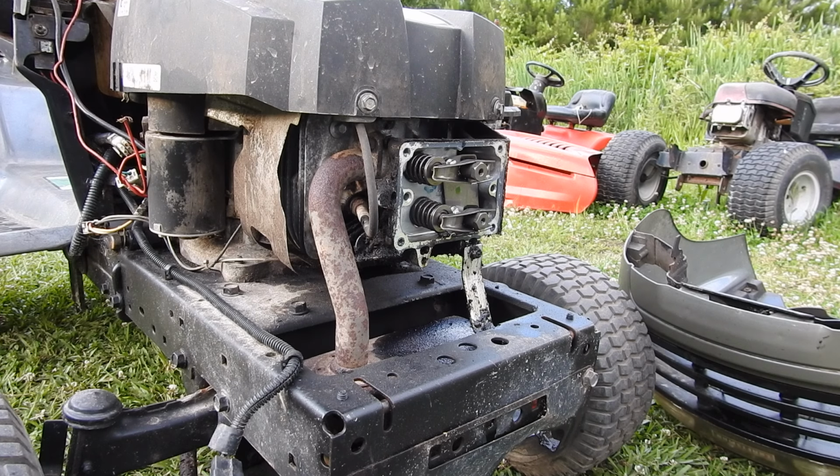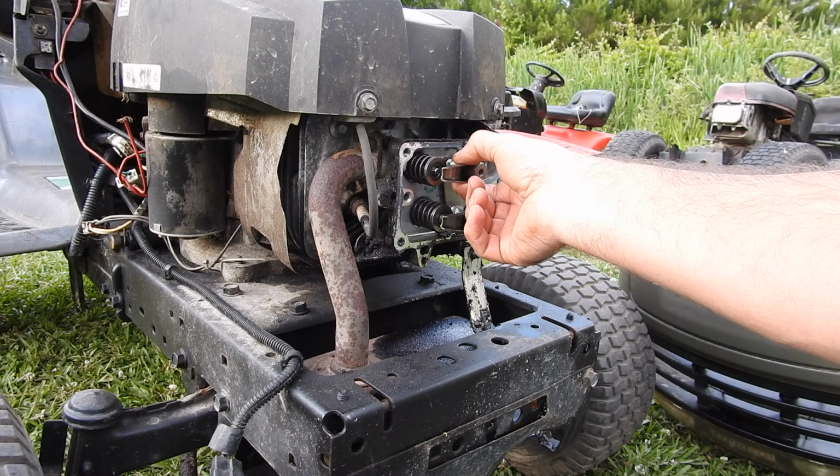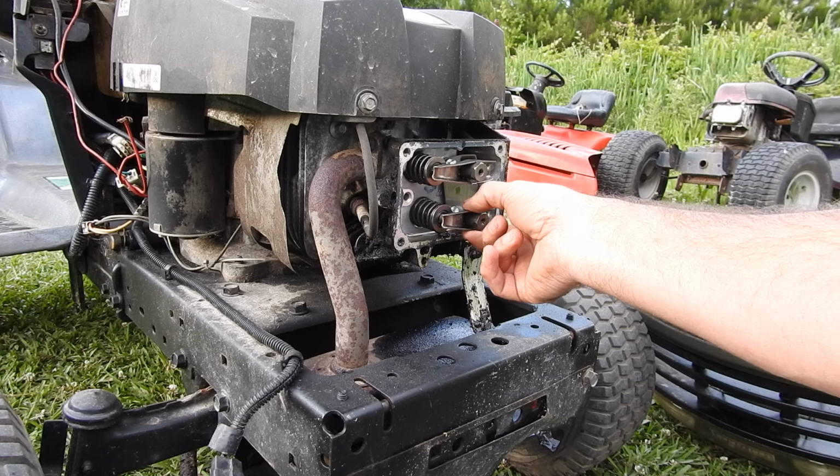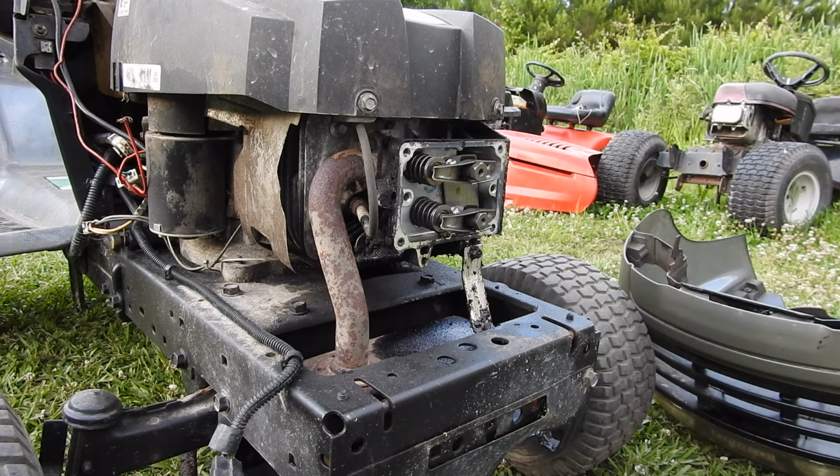I just went to go for another speed check. I went last night, but it was so dark, the video's so shaky. Anyway, I got halfway down the driveway and it shut off. When you go to start it back up, it won't turn over. I checked my valves. The exhaust is really loose. So I'm gonna tighten that baby up and then we'll go do our speed check.